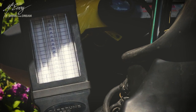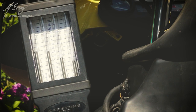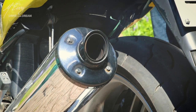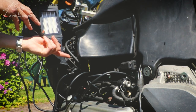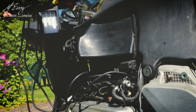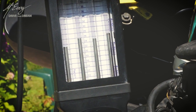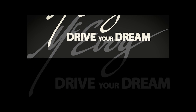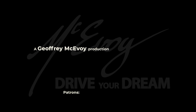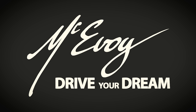Now time to adjust the butterflies — it runs like a sack of rocks; look at that, smokes like crazy as well, not supposed to do that. But that eventually died out as it hasn't run in a while. It took roughly 20 minutes to get it right: the bike has to be at operating temperature. Idle is set at 1,100 RPM; it runs beautifully, drives like a dream — I absolutely love this bike. Thank you so much for sticking around for a little under 20 minutes listening to me babble about the K1200RS.